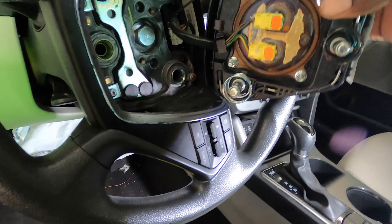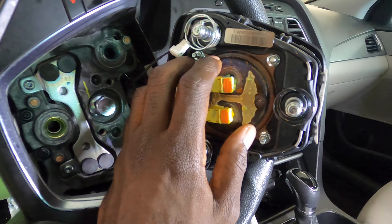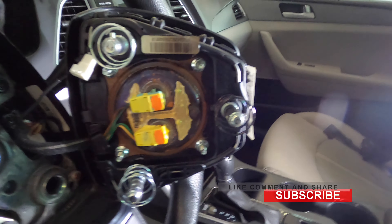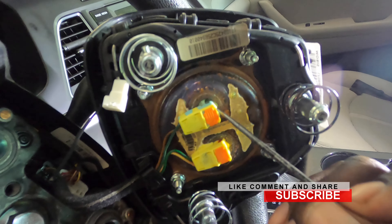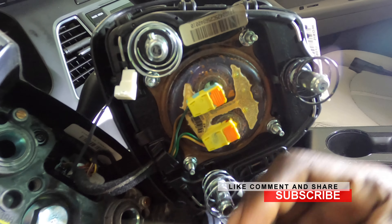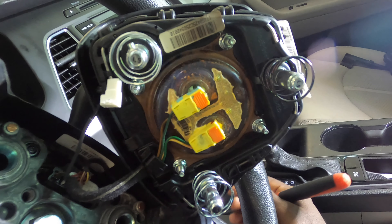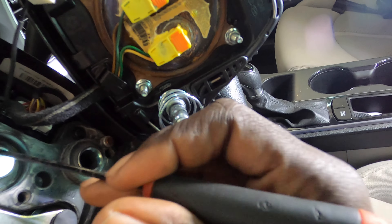When you get into an accident, this is like real fire — an explosion goes off in here. On the plug you will see that the plug is melted. Don't even waste your time trying to take it off; it won't work. You're going to have to order a clock spring.